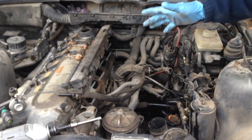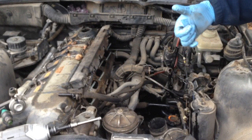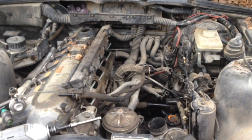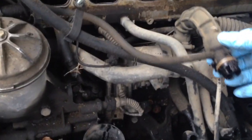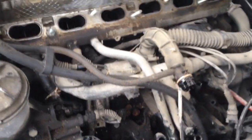We don't know if this head is going to be good - if the head is good it's going to be for sale. Since an electrode fell down in there we've got to make sure the head's not all beat up. There it is - the intake manifold is off, so really not too hard of a job. I'd say a three or four out of ten; for beginners it might be pretty difficult. With a little time and the right tools it'll come right off. We have our cold start valve - that just pulled out of there, no problem - and our ICV.